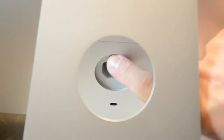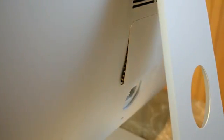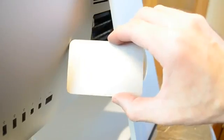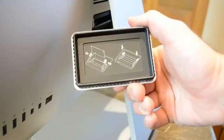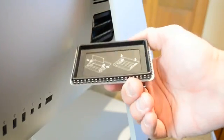Now unique to the 27-inch iMac is a user-accessible RAM panel. This means we can easily upgrade our own RAM, and this time we don't need any tools to do it — no screwdrivers or anything like that. Now concealed in the power port is a button to release the panel; you'll probably need something small to push it — I just used my SD card. The panel pops off, held on with anti-vibration friction fittings along the side, and inside the panel are instructions on how to remove or install your own RAM.